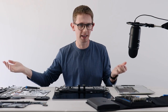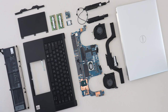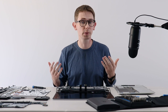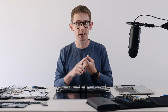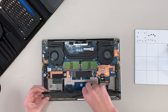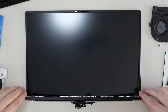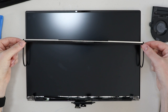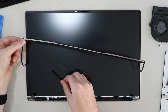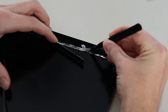It's actually a couple days later, but I am finally here ready to give the Dell XPS 15 a score. It's earned a 9 out of 10 on our repairability scale. I actually really recommend this laptop — with a 9 out of 10 repairability score, you know that it will last you for a long time and you'll be able to replace just about any component over the lifetime of the machine. It turns out the display is actually modular — you can lift up the plastic bezel and then another plastic cover, which gives you access to stretch release adhesive, letting you remove the display all by itself without removing the whole assembly.